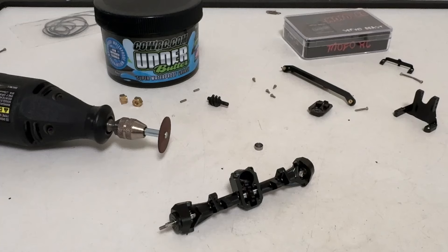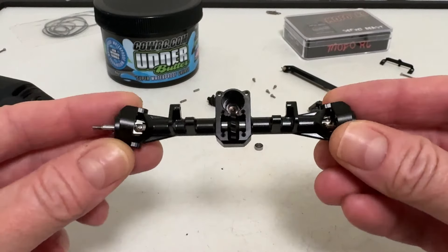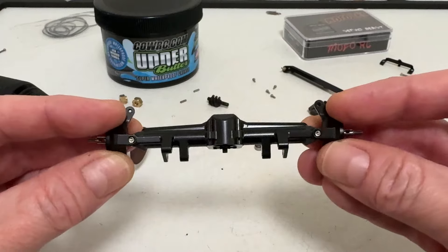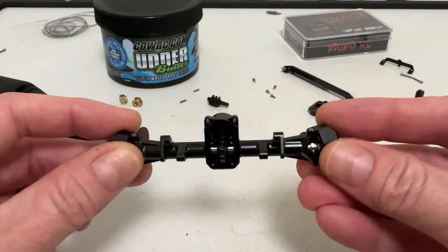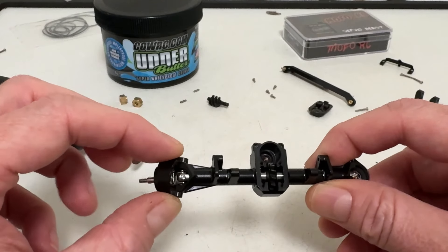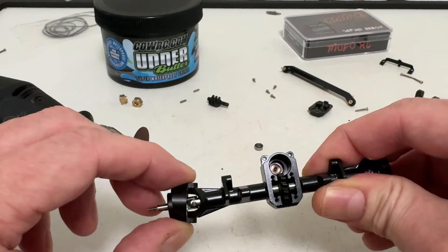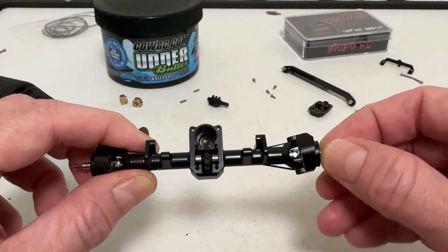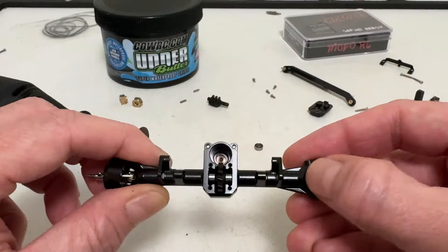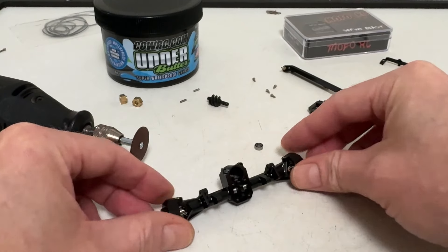Didn't get too far down the road without encountering my first opportunity - and I say that because it's an opportunity to get out the Dremel. I've got my little sanding wheel attachment on there, which is a great way to take a little material off of flat surfaces. The knuckles would not slide on to the end of the axles - that classic case of black coating on both parts. I always pick the less expensive piece to modify, which in this case was the knuckles. I took a little material off the top and bottom of the mounts. They're still tight, no up and down play, but they're nice and loose now and obviously fit on the axle.